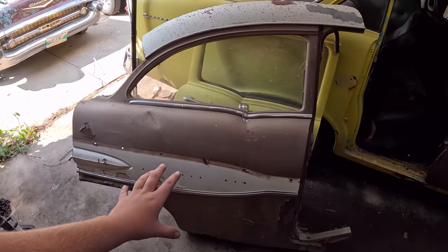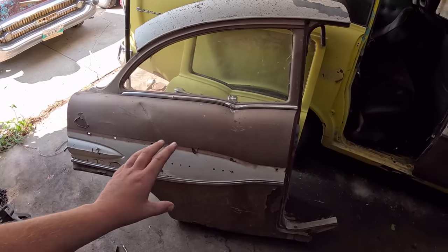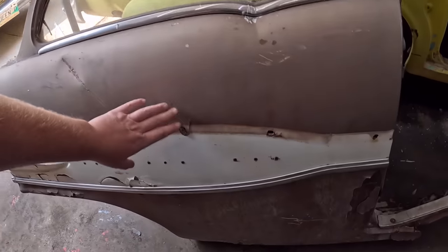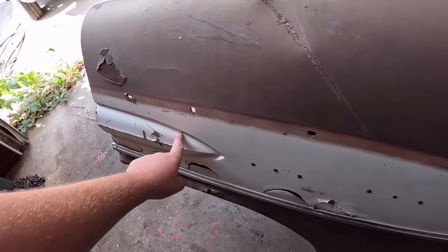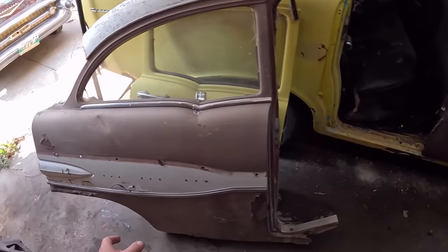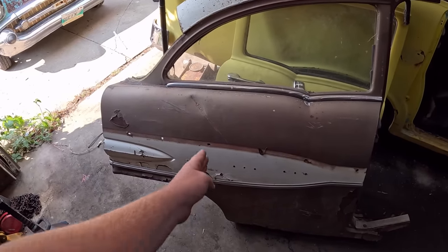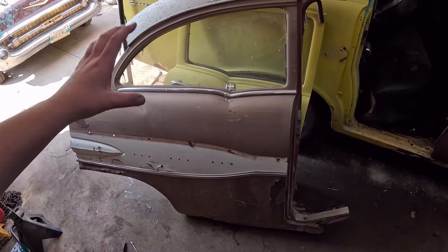Now this plays tricks on your eye a little bit. This is a Canadian Pontiac quarter panel. So you think it looks kind of goofy. It's just, those are his trim lines. The stamping doesn't start till back here. And obviously, however much ahead of the wheel, you'll do like a jog like that. So we're going to try and use as much of this panel as possible.